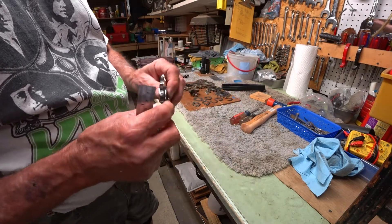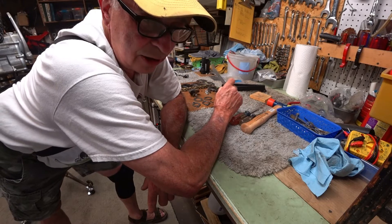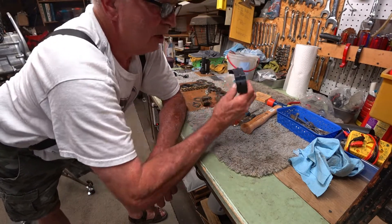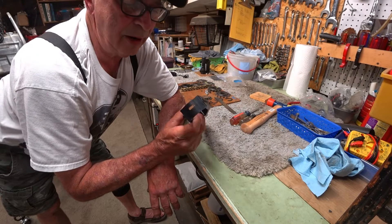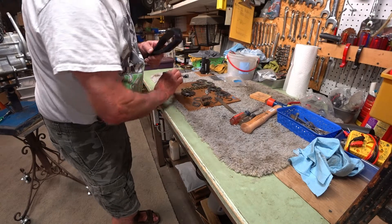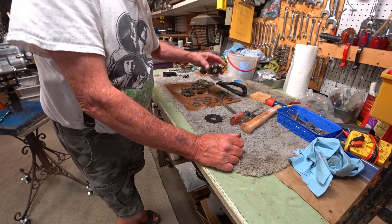These sprockets are reversible and they're aligned. The reason I say aligned is because some people put on the XR650R sprocket — I've never done it, but if you put that sprocket on, your chain won't be aligned. When your chain's not aligned you wear opposite of where you used to wear, you widen out and chew up your chain sliders. The chain should run right down the middle of your slider and wear in nicely. On my '92 I've never replaced it. If you run a sprocket out of line or put one on backwards, you'll immediately start to wear it in a funny way and end up with a misaligned area.